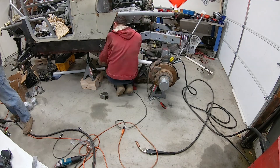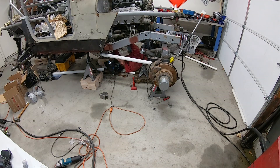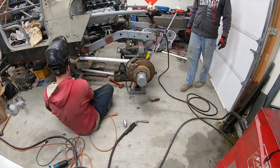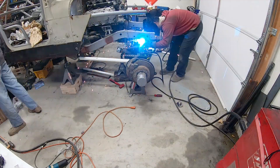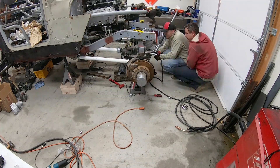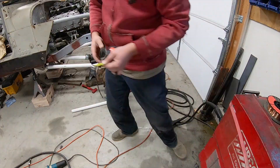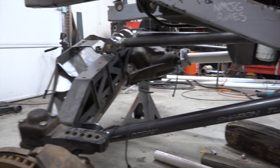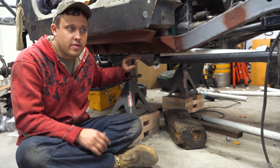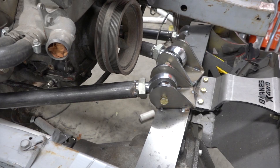We wanted our upper links a little bit shorter than our lower links to maintain a little bit of caster angle through suspension travel. We figured out what 75 percent of the lower link length would be for our upper link, and that just wasn't going to work — I'll show you why on the top end. We started on the lower links, got those where we wanted, and then made the upper links work along with that.